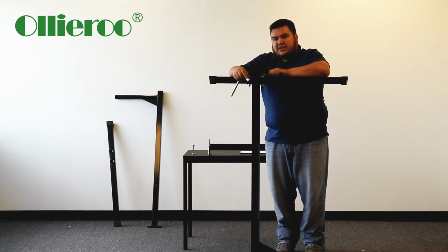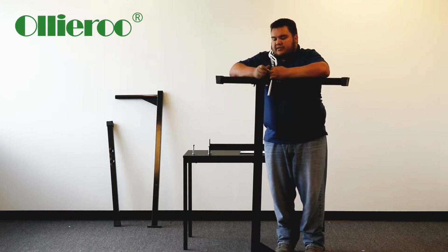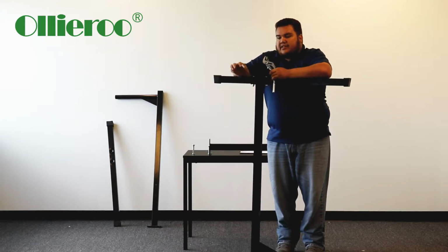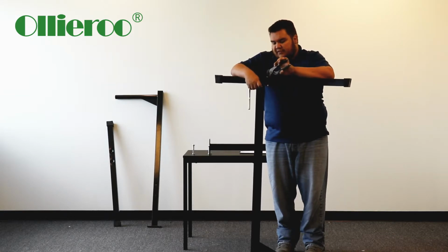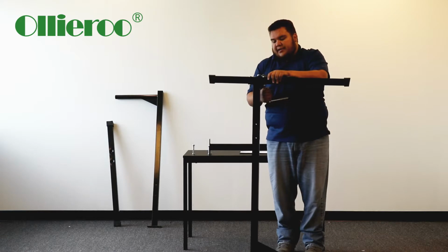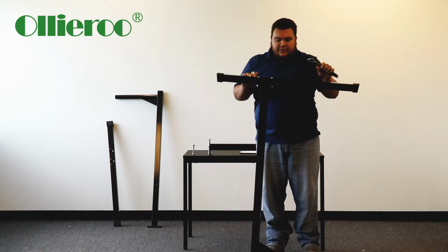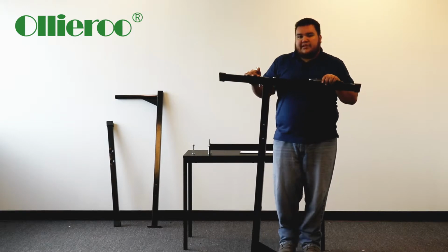but if you have a deeper socket, meaning the socket is longer, so this part right here, if this piece is long, if you have a longer 17 millimeter socket, I recommend using that, but I was able to get by with this. So pretty much I used the vice grips, or you can use pliers, held on to the top screw right here, and then just secured it from the bottom, and used the ratchet to tighten it up on the bottom. And this is how I got it. Like I said, if you have an extra set of hands, which I don't, it'll be easier.